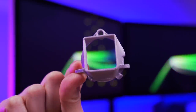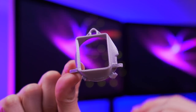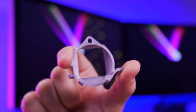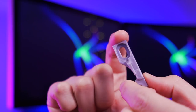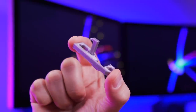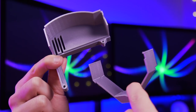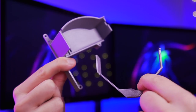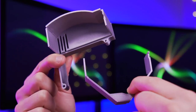In order to make all this stuff fit inside the console, I had to 3D print quite a few components. For the fan, I printed a new shroud which doubles as a mounting platform. Because the new fan shroud occupies more space, it interferes with the Dreamcast's lid release mechanism, so I had to print a new modified one as well. And lastly, to keep the existing airflow and to give the console a more polished look, I printed a bracket that secures the GDMU. This is a custom one that my buddy Kyle made because all the ones I found online didn't really work, but I'll get into that later in the video.